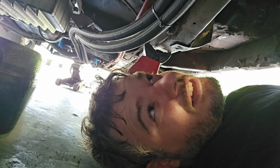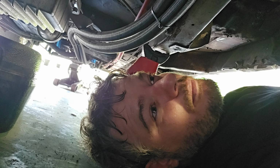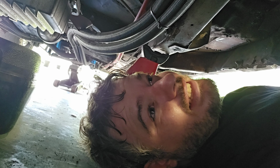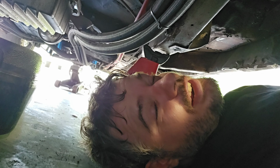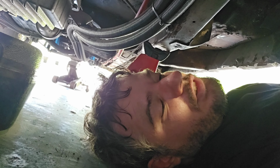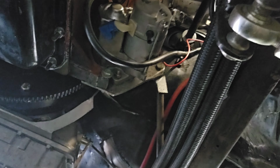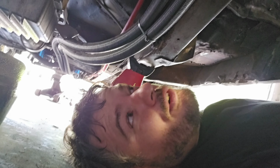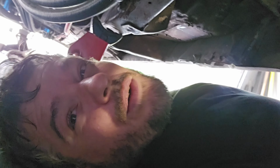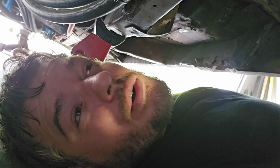It's got 14 degrees while cranking. And then after it sees 600 RPM, it goes up to 38, which is our base timing. And then obviously you pull for boost. And people are like, oh, it needs a starter. Well, it's got a Powermaster. And they said, you're also going to knock the nose off. It doesn't have a nose. What that was, was a 16 volt battery that only had 15 volts in it.